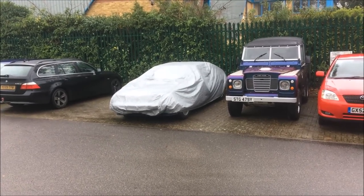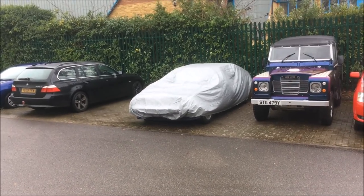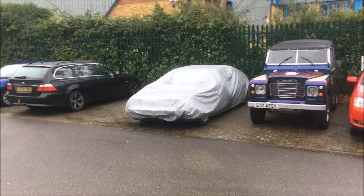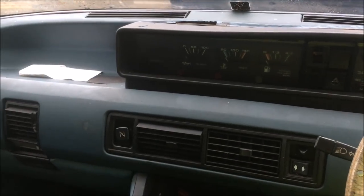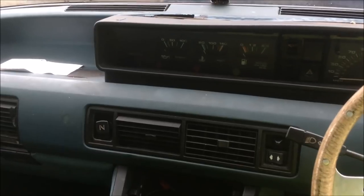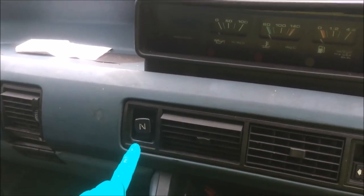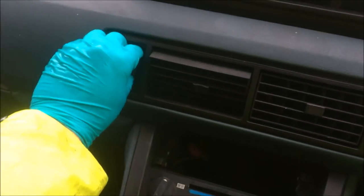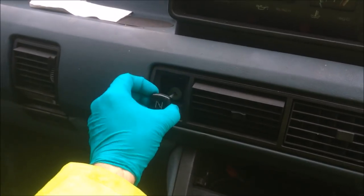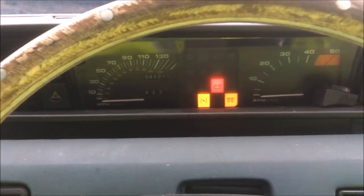It's a rainy Saturday morning, about 9 o'clock, and despite the rain I'm going to crack on with the cooling system on this car. My mate Jason came around yesterday — he's very knowledgeable on the SD1 turbos because he's had a few; in fact he's still got one he's restoring. Turns out I've been mistakenly using the cold enrichment lever — I was just pushing and pulling it, but apparently you pull it all the way out, then turn it to lock it, then do your glow plugs, and you're supposed to start it with your foot flat on the accelerator.